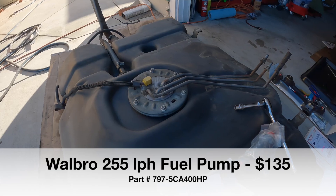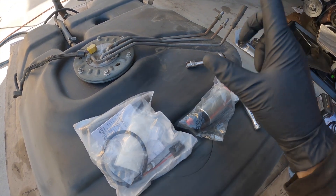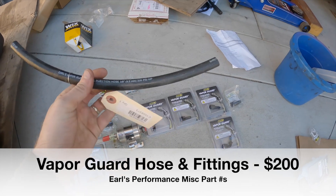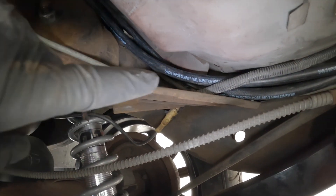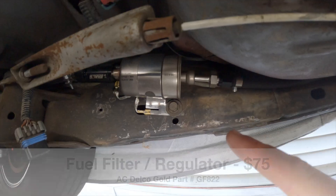Moving on to the fuel system, which is going to cost about $410. We used a Walbro 255 liter-per-hour in-tank fuel pump — a 1994 to 1996 Impala SS or Roadmaster drop-in fuel pump that also works on the '91 to '93s with a little bit of modification, using the original sending unit. We also used Earl's Performance Vapor Guard fuel hose as well as a miscellaneous set of AN-6 fittings. AN fittings — Dash 6, Dash 10, Dash 8 — add up really quickly; the cheaper ones are about $5 each and can go up to $20 each for Dash 10s. The Vapor Guard is rated to 225 PSI; we're using only 60 PSI. During the build we had to pick up a couple extra fittings from other brands, and they were not as good. And last but not least, we have the ACDelco Gold Fuel Filter — a part number straight out of a C5 Corvette, which is what GM recommends when installing this system in a hot rod.